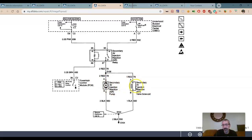and this thing is a passageway that opens up. Right? So this thing, and then this thing is a solenoid valve that allows that air pump to move into the engine like it's supposed to, or the exhaust or whatnot. Kind of cool if the secondary air pump doesn't work. Okay.